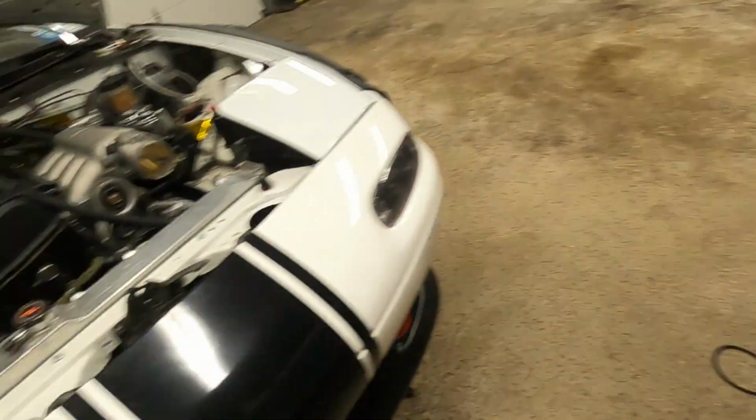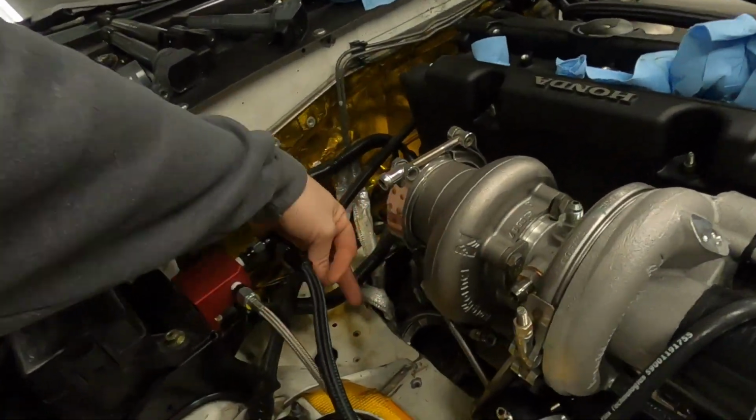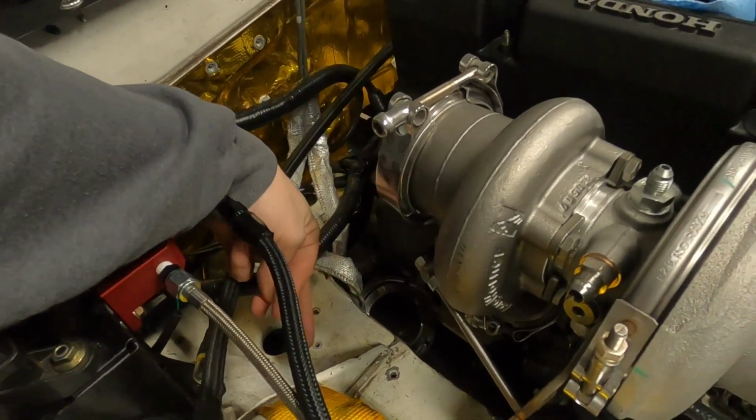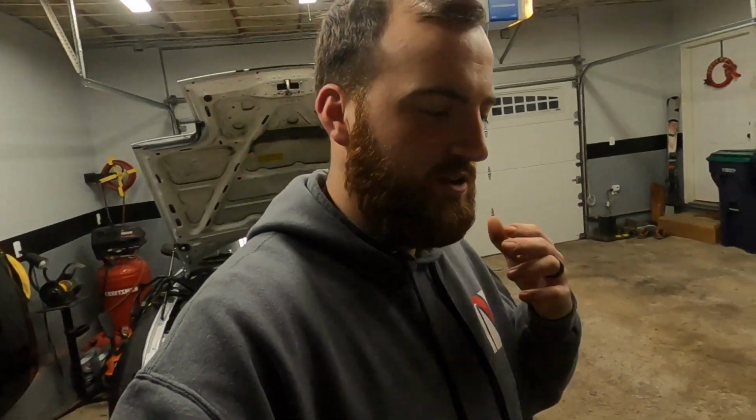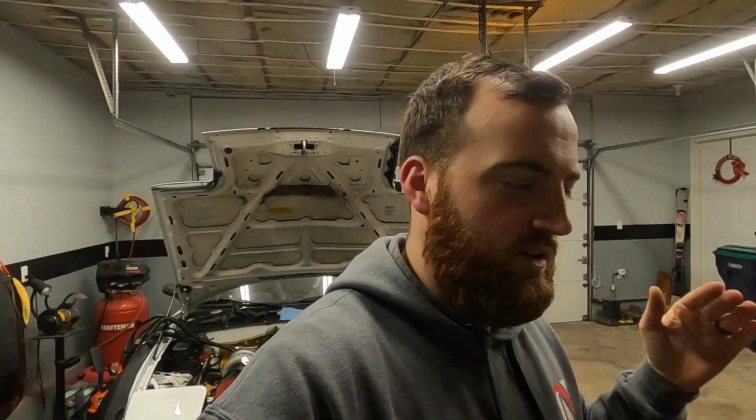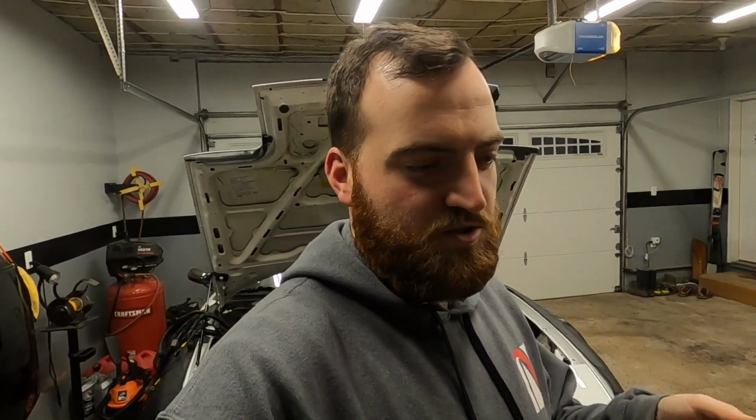And it'll kind of put them right around here, sticking out this way, and that way I can keep my existing O2 sensor wiring locations, and I'll just feed the second one, which is the gauge one, into the engine bay. There are 2 spots on that crossover pipe underneath that are kind of right under the driver's seat. Those would work. I just want options. I'm not sure where Rick is gonna say is best. I'm gonna weld these on, that way I have the option. They might be too close to the turbo, and it might be bad for the O2 sensor.